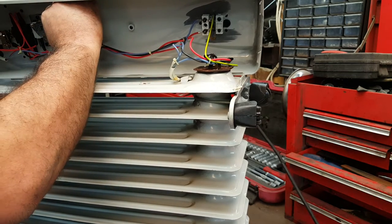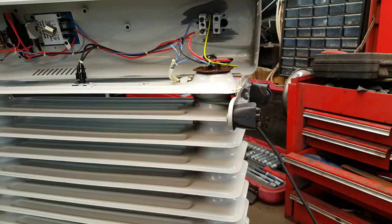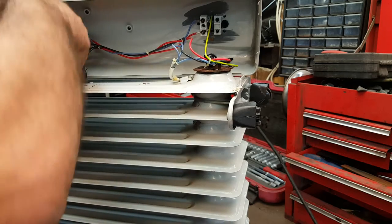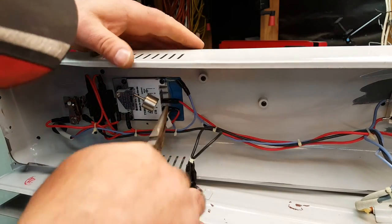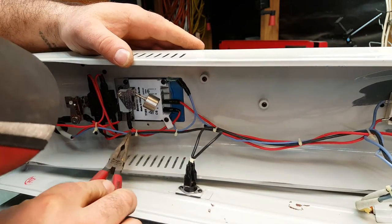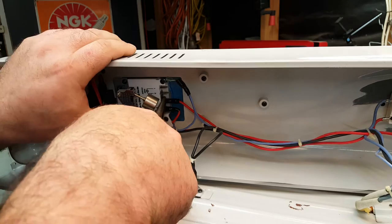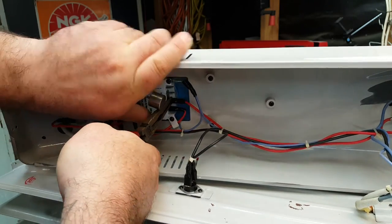So we've got some wires here, we can unplug those. I think long needle pliers for that one. Okay. So just see if we can lever that off there, not damaging anything else. That's the insulation out of the way. One. And I suspect that this is the feed going down to the actual heater element. Yes, it is. So that'll be your power in, tilt sensor, and yeah, main switch there, look, coming in. Cool. All right, well, that basically, if we just join those two red wires together, tilt sensor, that's one.